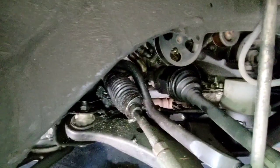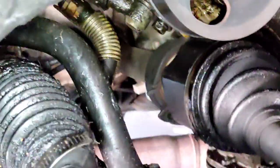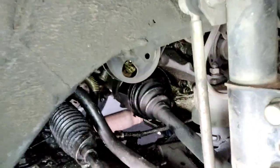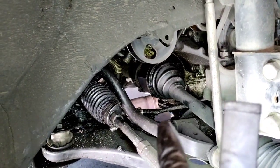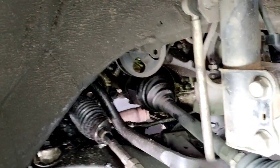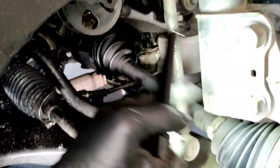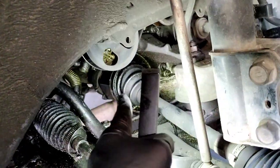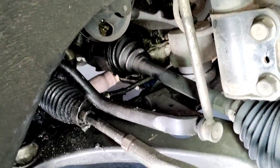There's a carrier bearing back there, right there. I haven't had one go bad. They still could fail and cause some issues, but normally it's the yoke inside the boot that fails, on the basket or whatever. Inside of here, that's normally where the issues arise. So let me start it up, see if I can get it to rotate, and we can probably take a look at it. We're not likely going to see it in action, but maybe I'll see what I can catch.